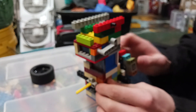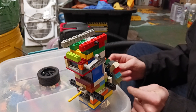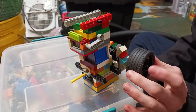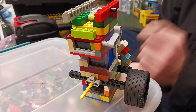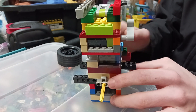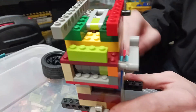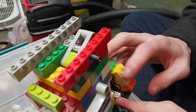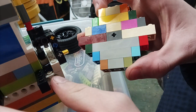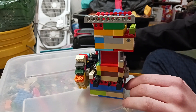I tried running it with little support arms but it just slowed it down, losing a lot of power. Then I did the circle tire at the same time with the ram for the flywheel — it doesn't like it. I went on YouTube to find out why it wasn't running properly, and it turns out these overhead valve engines don't like the circle flywheel, so I had to make a whole custom flywheel from random parts I had laying around. Let me give you a little sound of what she sounds like.